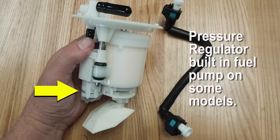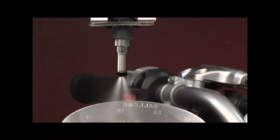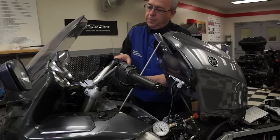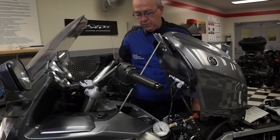The fuel pressure is set by the fuel pump and pressure regulator and should not change under any condition. The air-fuel ratio — basically the amount of gasoline sprayed into the engine — is controlled by the length of time the fuel injector is open. The longer the injector is open, the richer the air-fuel ratio. There's no sensor to monitor fuel pressure, so it's up to technicians to verify if fuel pressure is correct when troubleshooting a running performance complaint. If fuel pressure was low, less fuel would be sprayed into the engine, so it would run lean and the engine might stumble or hesitate during acceleration, but there would be no fault code triggered. Please don't forget this basic step when working on FI models — you could waste a lot of time needlessly testing dozens of FI sensors and circuits.